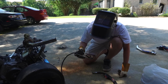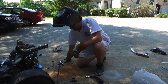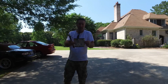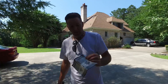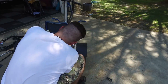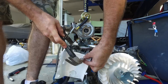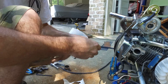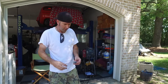It's a little tougher to weld thinner material, but let's see what we can do. I don't have a gasket for this intake, so I'm going to use this old belt package — a piece of paper — to make a gasket, the way I've been taught a long time ago. Et voilà — gasket.